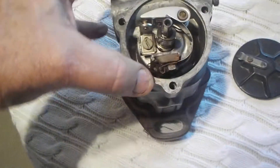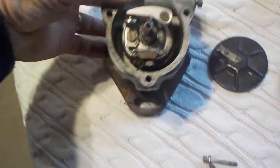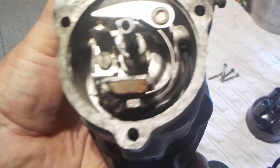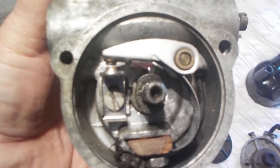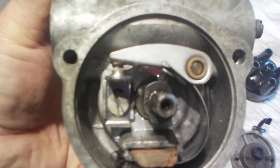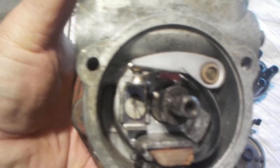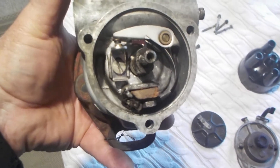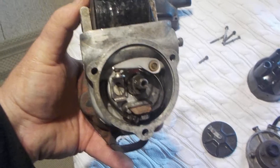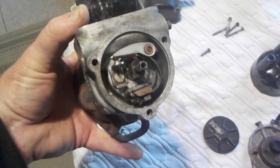If that doesn't work, then you just connect the three wires, seal them up as best you can, and have your wire coming out the front — you cannot be touching a ground. Now, the setting of the points: you've got to turn it to the high point — that's your high point on the cam. See, those points are open. At that point, for magnetos it's .013. For distributors I believe it's .020. But for magnetos it's smaller, because a magneto gives a bigger spark.